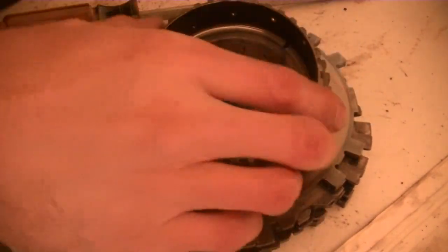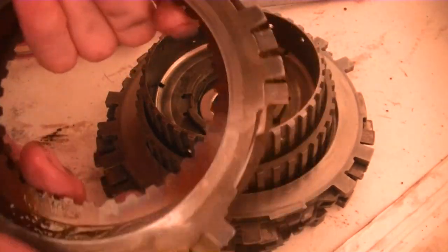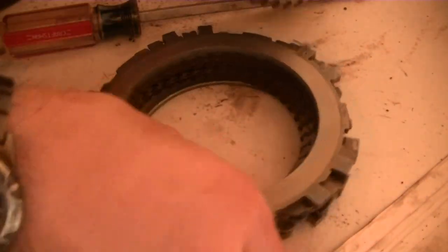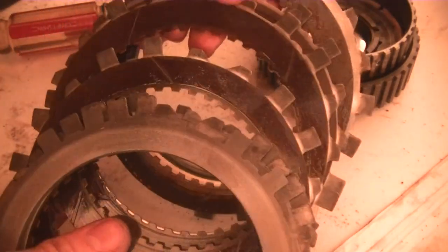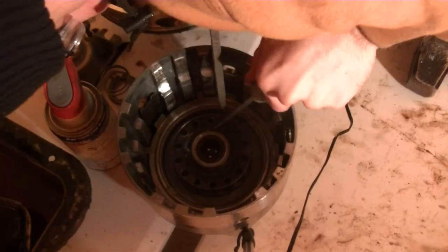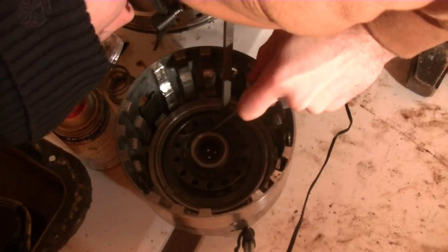On the smaller side of the sprag, there are two steels that look like this. I'm telling myself on camera how it goes back together just so I don't forget. I think these are good — it's hard to tell if they're high energy or if they're burnt. Check the direction of the sprag: it should only turn in one direction and lock in the other.